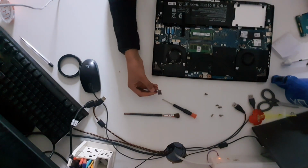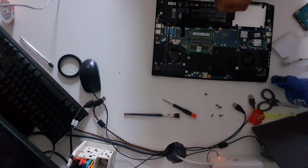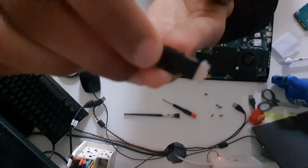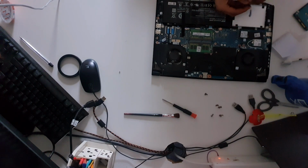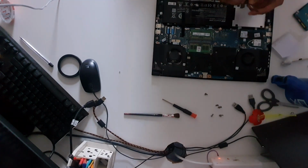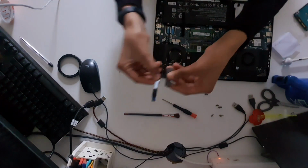This is the HDD Upgrade cable. So, you want to make sure that this backplate with the metal connects to the bottom, and then this has a little bit of fold, which will fold kind of like this. And don't worry, it's 100% safe. So, we'll end up with a fold that looks like this.